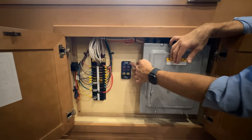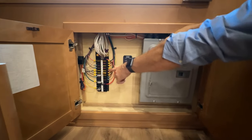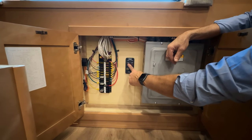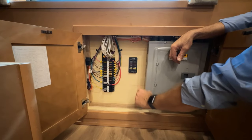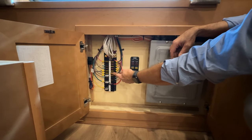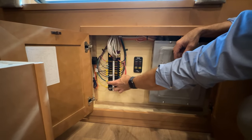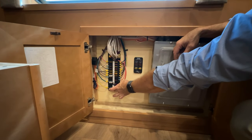We give spare fuses here. If you have a fuse that blows, these are your spares to replace. Make sure that you use the same number, which is the amperage of that old fuse, when you replace it with the new. These are like fuses. They're bigger. They're called mini breakers. They're automatically resetting, even this one, so that you don't need to change these larger sized ones.